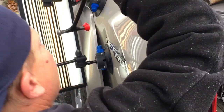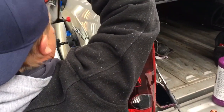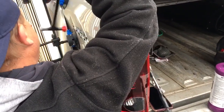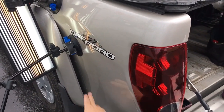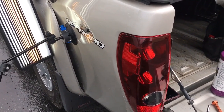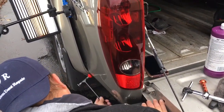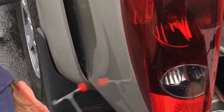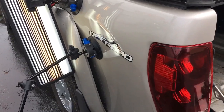So I know we're not gonna keep you guys in for the whole thing. It's a really big dent, but it's a nice car for a nice guy and we want to do a good job. I'm gonna try some glue pulls along this edge — I might even just get underneath it and try to manhandle some of that dent out. But it's a lot of this brow down here. I have to break — and see, that kind of popped it back in. It's wanting to do this oil can thing.